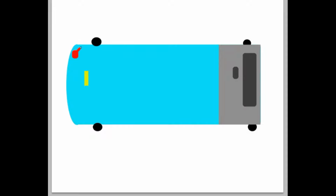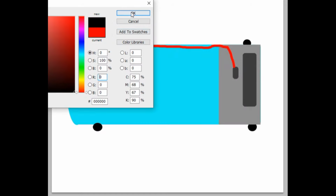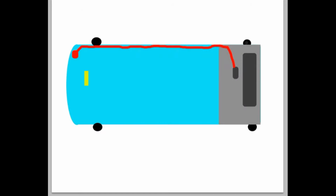You'll take this wire and you'll run it however you can see that's the best way to do it, through the side of your vehicle to make it look good, and it will hook to your amp into the power spot. It looks different on every amp, but it should be able to tell you. If not, look at the directions and that's where your red cable will go, and that'll obviously hook on the positive of your battery.